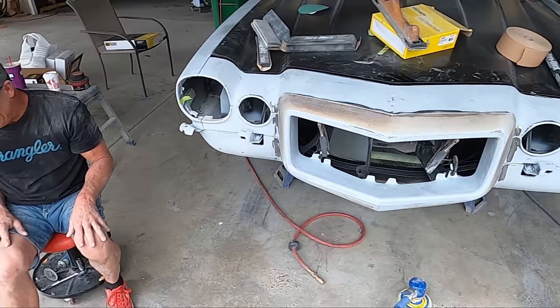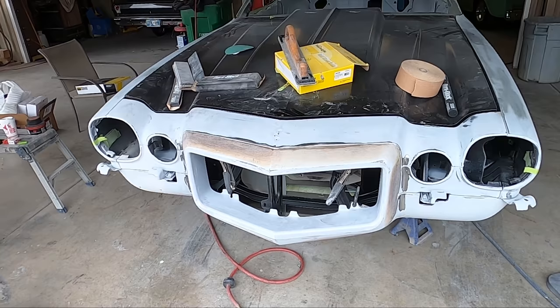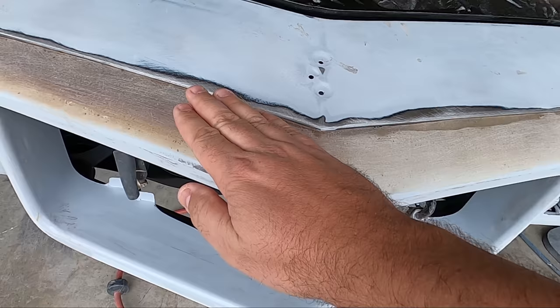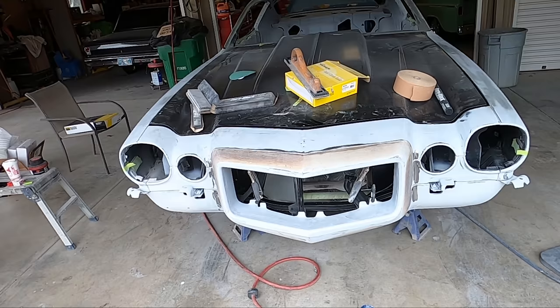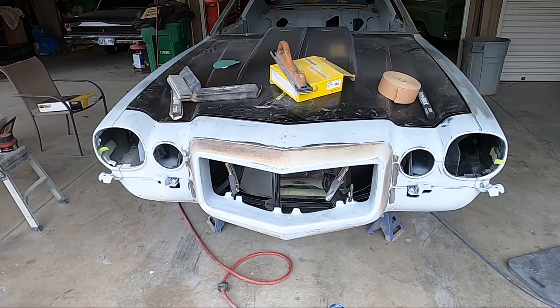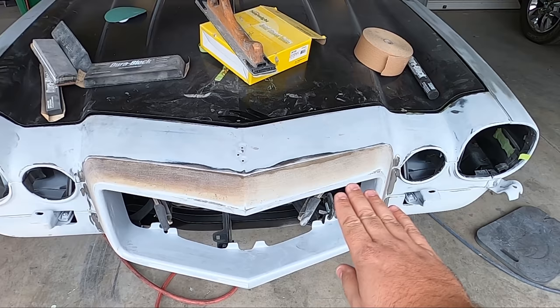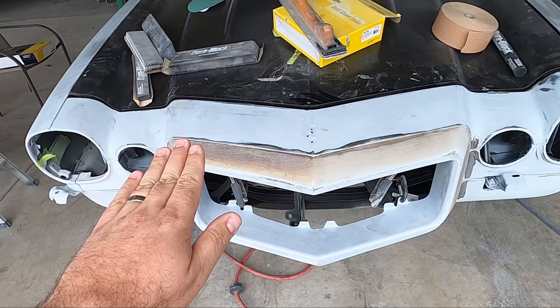Okay, so since he doesn't want to talk about it, I guess I'll have to talk about something I know nothing about. We've added layers of fiberglass to the already fiberglass nose. As I mentioned in the previous video, it was way off on this side by almost half an inch, maybe more. This whole upper edge sat too low. The bottom was actually okay, we didn't have to put too much fiberglass on there. But as you can see here it's all smoothed out and sanded. I think he used 80 for his last pass, just grinding it down.